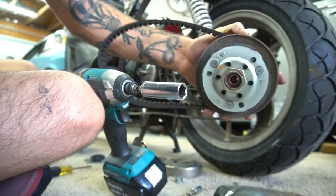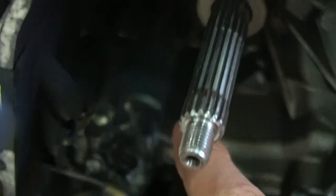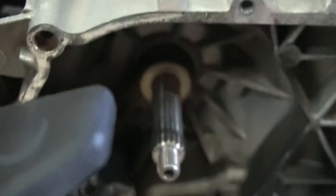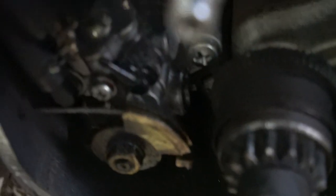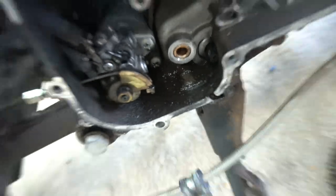This clutch looks pretty new on this thing. You can see the little belt back there and it drives the oil pump by a big old gear, right off the crank. That's actually pretty cool — never seen that design of an oil pump yet. I noticed that this line right here for the oil pump was unhooked inside the block too. Look at all that oil that came out in there. That makes a lot of sense.